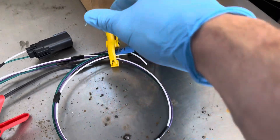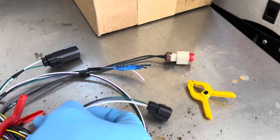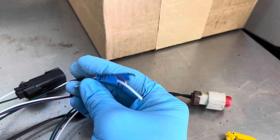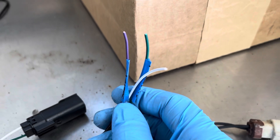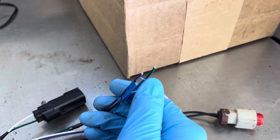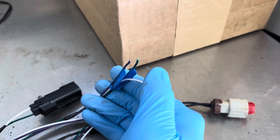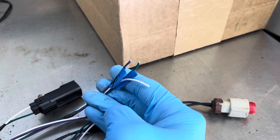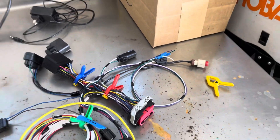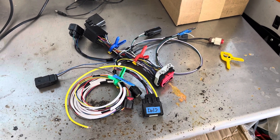The select shift is on all the 2011 to 2014 F-150s and probably all 2011-and-up trucks. The colors are the same as the AC switch. You've got your shift-plus, shift-minus, and a signal return wire. It doesn't use the 12-volt system like tow haul mode — it uses more of a 5-volt resistive system. It sends 5 volts out and whatever resistance the switch has brings it back, and the computer knows whether to go up or down. Mustangs use the same wiring, so people doing automatics in S197s have also requested those wires be broken out so they can have that option.